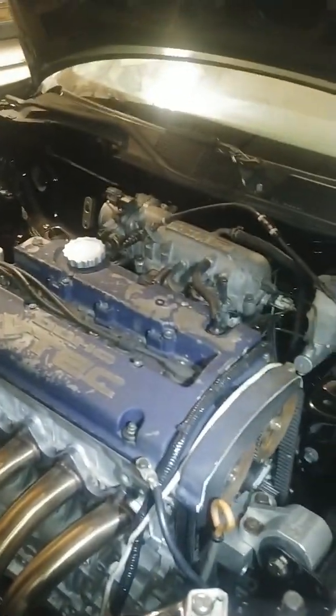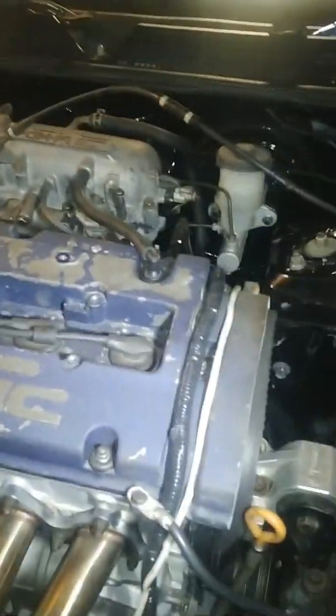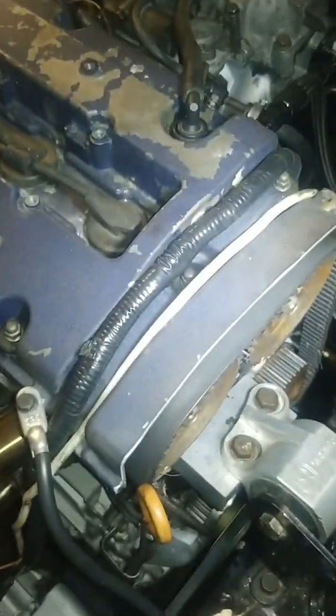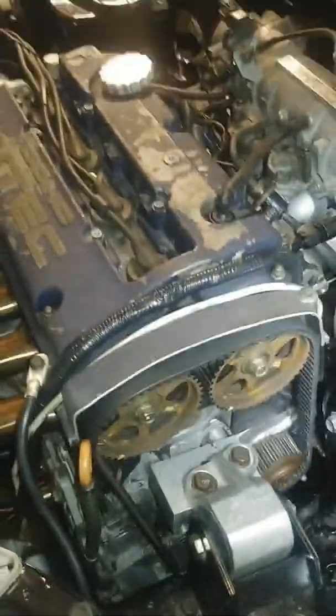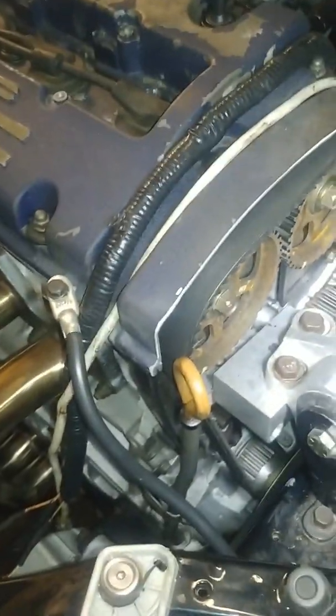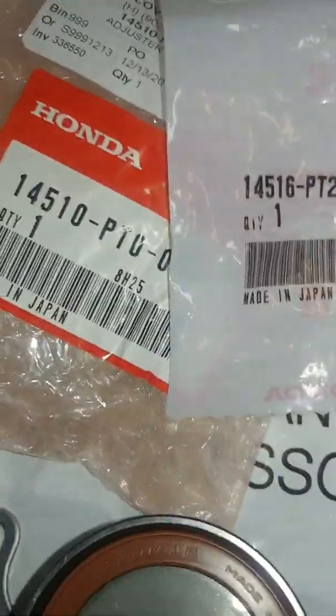The proper way to do this for all the H guys — H2B, I got the same setup on the all-wheel drive car — is the H23 A1 non-VTEC manual tensioner. So basically it's a B-series manual tensioner. If you're not an H-series guy, these come with an automatic tensioner — it's hydraulic fluid in it and you basically have to hold it down, put the belt on, do two rotations, check the belt tightness, it's supposed to tighten itself. The problem with that is yes it works, but if it fails you're gonna jump quite a few teeth. So the proper thing to do is get the KS Tune tensioner — that comes with the spacer in the QSD kit — and then this is the H23 non-VTEC manual tensioner. That's the part number here for the tensioner.